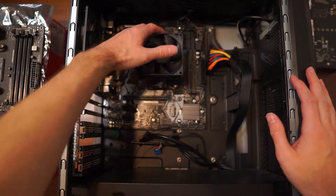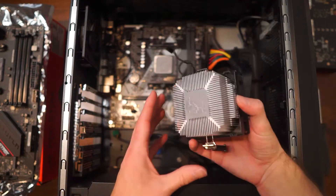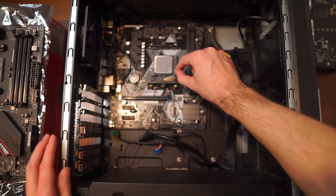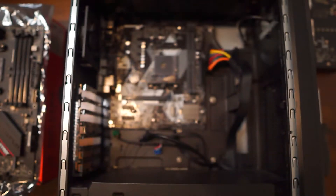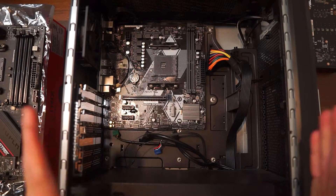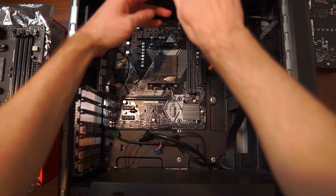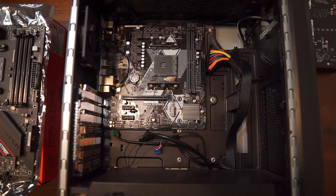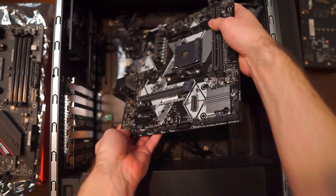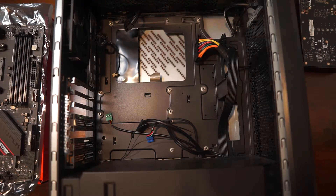I want to remove the CPU fan and the chip. After you unscrew and remove the fan, if you're going to be removing the chip, this process requires some delicate hands, so try to be careful. When you remove the chip, I would just immediately put it into the new motherboard as it's probably the safest resting place you will find for your CPU. Unscrew the motherboard from the connector points that attach to the case, and then remove the motherboard. Make sure to set it on something non-conductive — like a cardboard box or a wooden table — something that will not contain any electric charge.